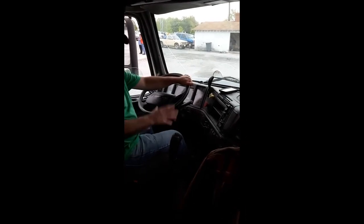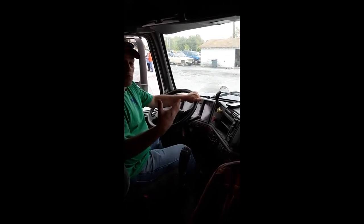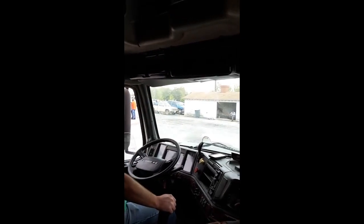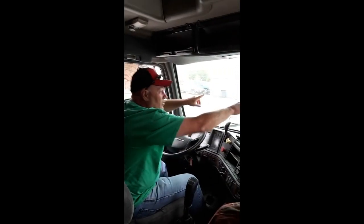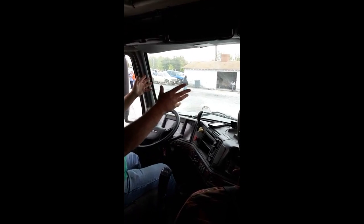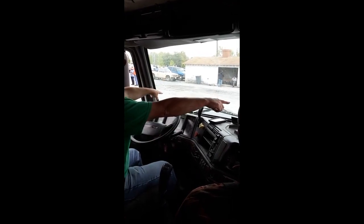At this stage, you've already done your light check operation. You'll be in the driver's seat, and I'll be in the passenger seat. The simplest way to do your overview is to start at the top and work your way down. We have no overhead obstructions. Nothing's going to fall on me, injure me, or inhibit my ability to drive safely. Move down to this level. What's this big thing in front of us? Remember I said you need to tell me about it twice. This is the second time. On the inside, it's clean. You can see through it. It's properly mounted and secured because you've got a gasket on the inside too. I'm looking through. What are those things on the corner?